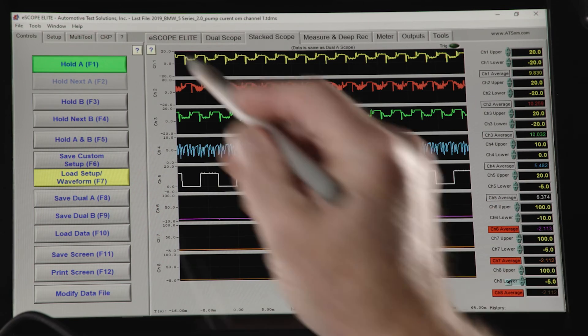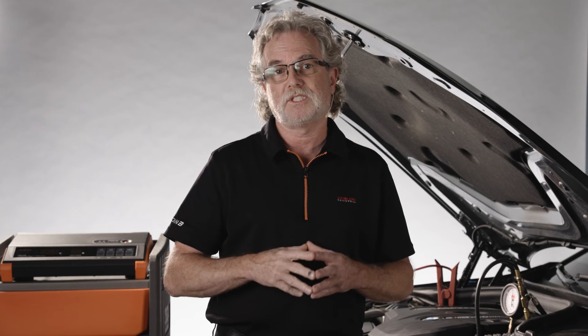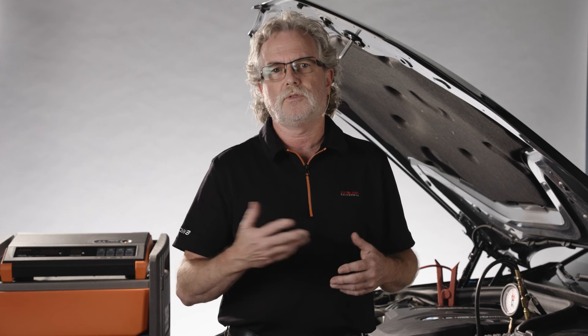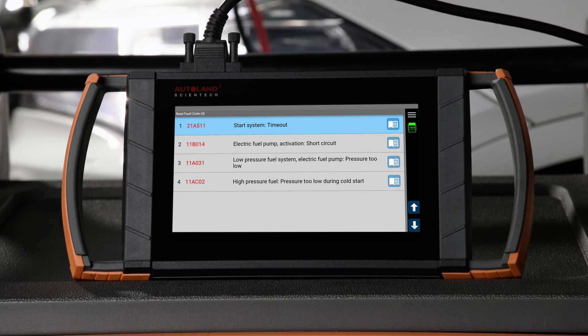So we've seen a known good signal. Now what about when there is a fault in the fuel pump itself? Normally what we see is low mechanical fuel pressure, under 30 psi, all the way to 0 psi. The engine will start and stall, hesitate, or just fail to start. You could also have fault codes stored for low or high pressure fuel system, or start system timeout if there was a no-start condition from a lack of fuel pump activation or short circuit.